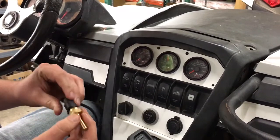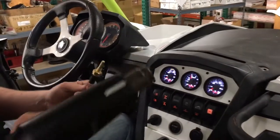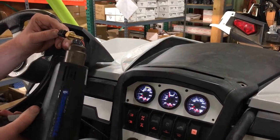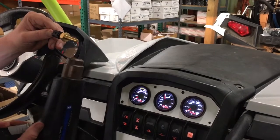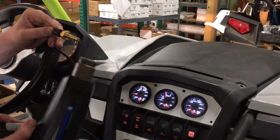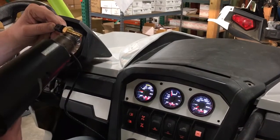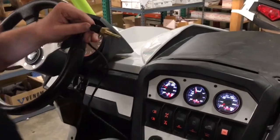We're going to plug it in — it's got a nice jacketed connector, make sure it's fully plugged in. Turn the key on, grab the heat gun. On high power, wave it back and forth — don't give it full power right off the bat, because that's not the temperature this car is actually going to produce. Definitely do not use an open flame source; it is a gel pack sensor and you'll boil the gel and break the sensor. We want to act like we're slowly heating up the belt. We see it spike up a little, give it a little more heat, getting up into that 140-degree range where the gauge is programmed — the light kicks on, the fan just kicked on, and we're good to go.